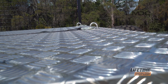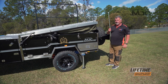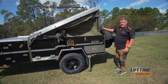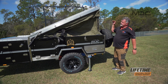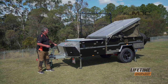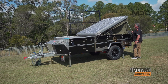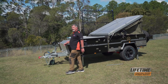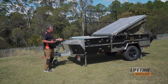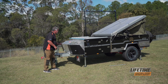I've run out some slack on the front winch so I can now get this connected up at the back eyelet. To make winching safer and to put less stress on the hardware and stop having a sheer effect on that top eyelet, I'm using a short spreader pole and placing it underneath the lid, just propping it up on the spare tyre here. That'll give me a great angle to start winching across. Now I can start winding up. Notice that I'm standing off to one side of the winch — stored in this strap is a lot of energy, so if the worst happens and the hook fails, I'm well clear.